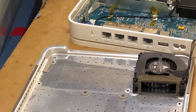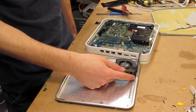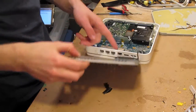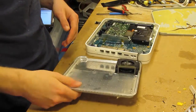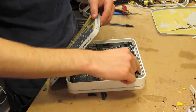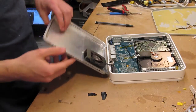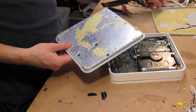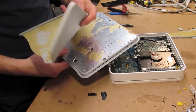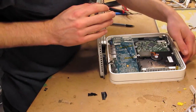Carefully pull this off to the side because the filter caps are still charged. Here is the actual Time Capsule. It has a decent centrifugal fan, except there's no real intake at the bottom — just tiny perforations. When the case is on, all the fan does is blow hot air from here, across here, and back again. So what I'm going to do is pull the fan off, cut a neat intake hole on the bottom, and put a hole in the base plate as well, so when the fan runs it sucks in cool air and forces it out the vent slot at the top of the enclosure.